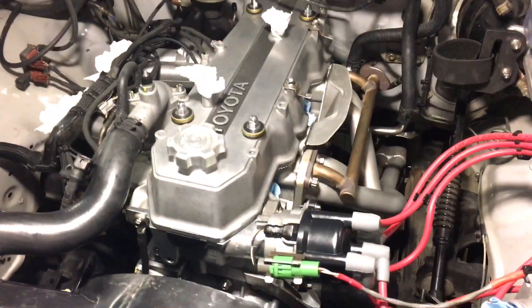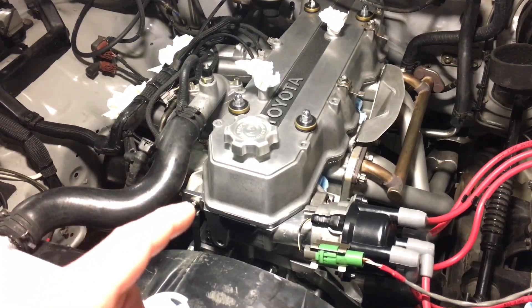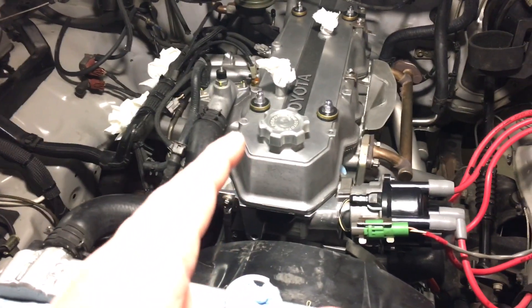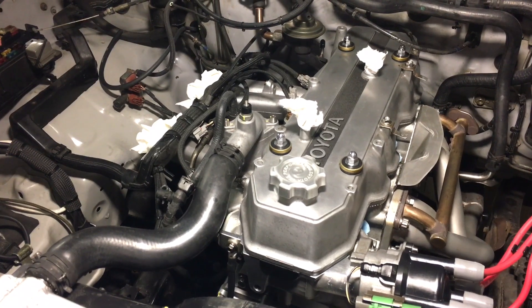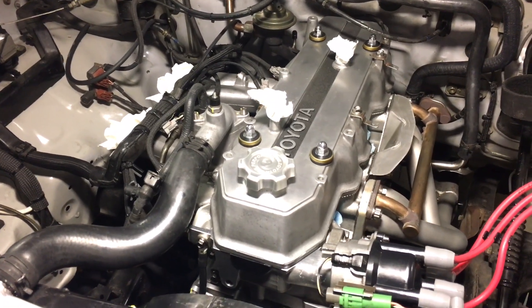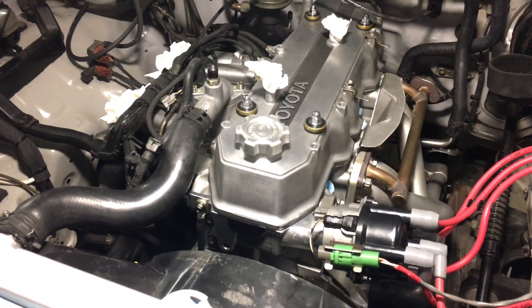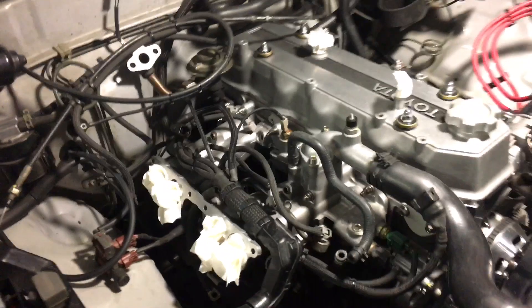I've got oil in the motor. I'm going to pull the 15-amp EFI fuse, leave the spark plugs out, and spin the motor over to pre-oil it. I used Driven Racing's HVL product and their engine assembly gel. I have to say I wasn't overly impressed with the engine assembly gel - it seemed like it just wandered off from where I put it. I'm going to go back to the Permatex Ultra Slick product for future engine assembly. Nothing against Driven - I'm running their engine oil - I just wasn't impressed with that gel.